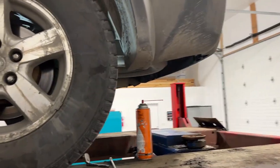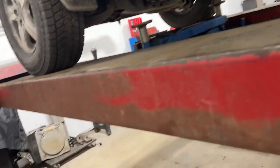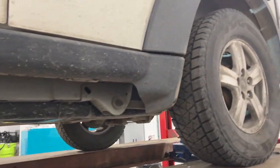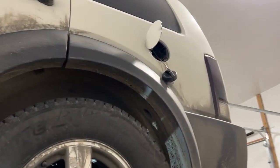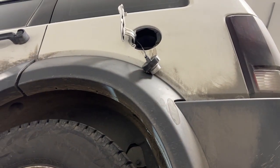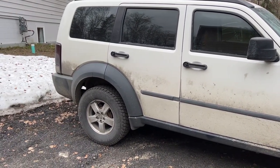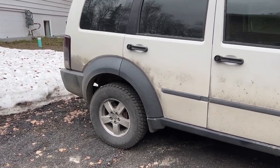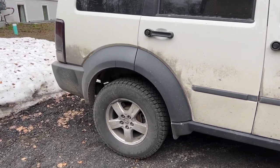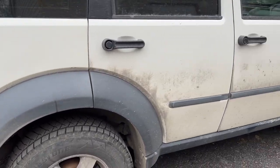This is an '08 Nitro. You can definitely experience this on any Chrysler or Jeep model where you're having an issue putting fuel in the tank. The cause of these symptoms may be a restricted fill pipe, some type of contamination down in the fill pipe, or maybe somebody tried siphoning fuel from the vehicle and left some type of contamination in it.